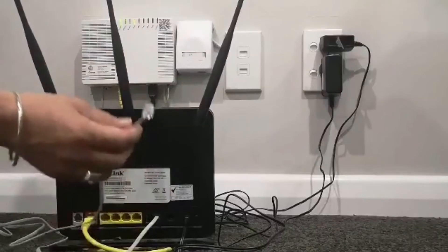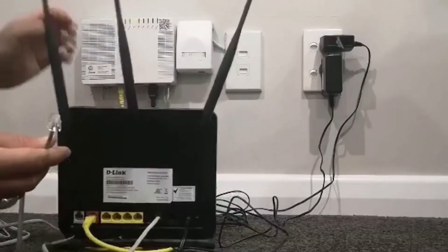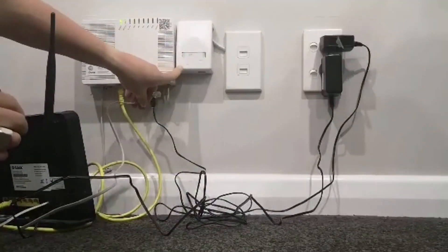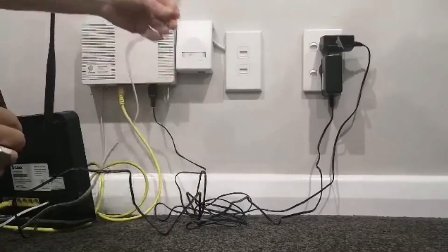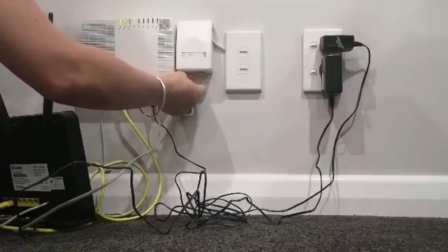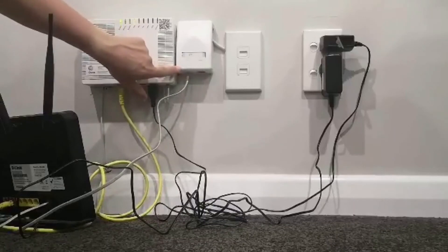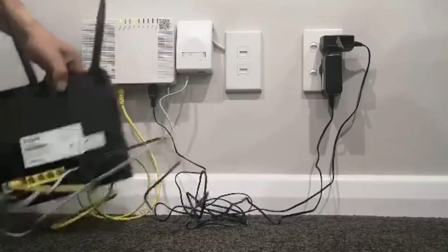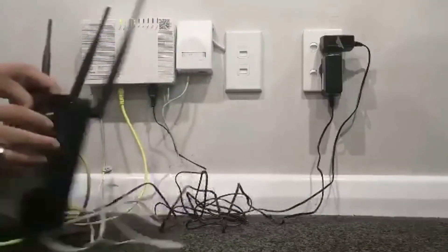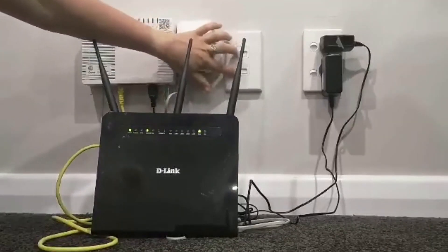Now if you've got multiple phones in your home, you need to connect the other side into the voice box next to your ONT. Plug this into SOCKET1 — once again that's underneath, so you might need to get low to check you've got it. That's connected from VOIP1 to the voice box, and then you should be able to use your phones through all the sockets in your home.